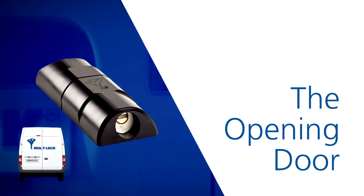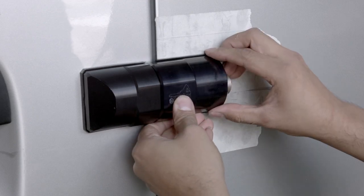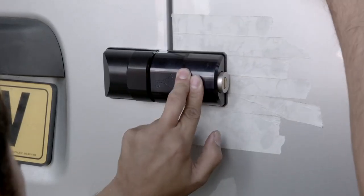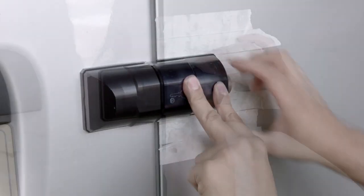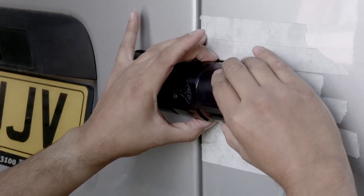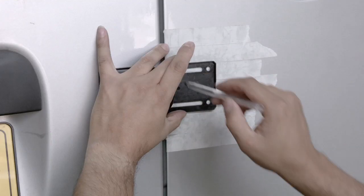The opening door. Take the remaining lock part and gasket and position it on the door. Whilst holding the unit in position, we can operate the door to ensure it opens and closes freely. If the body is touched during this test, we can reposition accordingly and also ensure that the locking bolt operates smoothly. Once our position is confirmed, we can remove the lock part, leaving the gasket in place to mark the two holes and the two slots as before.